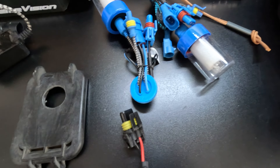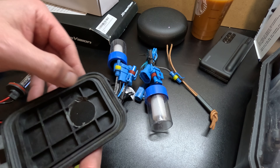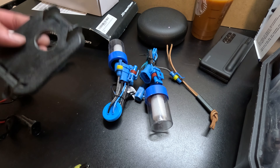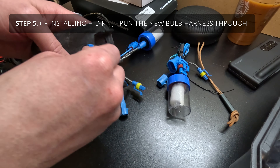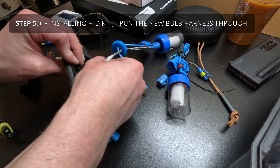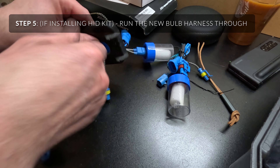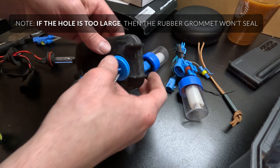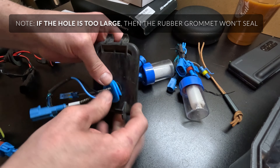I had to drill it to get the plug through — you want to have the light on one side and run the plug through on the other. Make sure the rubber seal is still in there and didn't get stuck. It's a really tight fit with this plug. The bulb's going to be on the inside, so I'm going to run these wires through the back — just squeeze them through. I tilted it a little bit to get it in, then tilt it inside. Then run the other wires through and pull them through — these are all going to plug to the ballast. Just try to get the outer notch, and sandwich this in between.